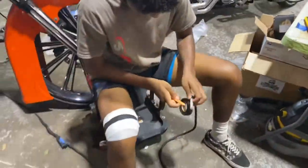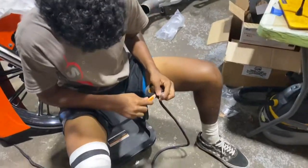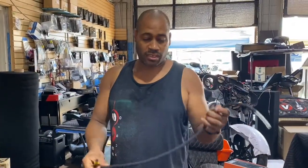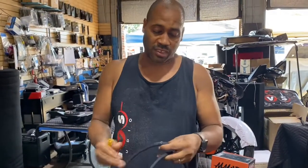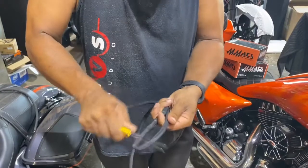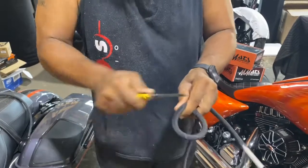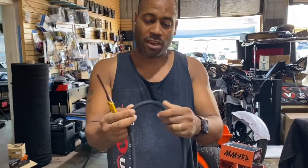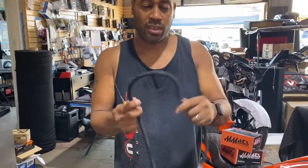Geo's taping up the harness with some heavy-duty tesa tape — makes it vibration resistant. Any wire that goes outside the bike or outside the car, we like to use this tape on because look how resistant to abrasion it is. If you have wire moving and brushing against metal, you don't have to worry about it fraying through the installation. I like using this much better than cheap flex loom, especially on the power wires.